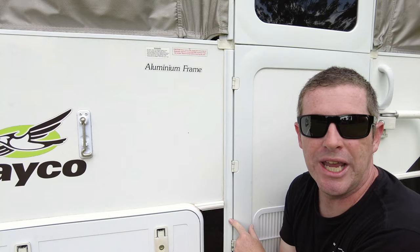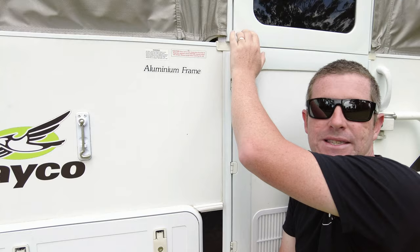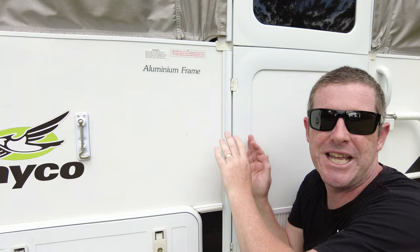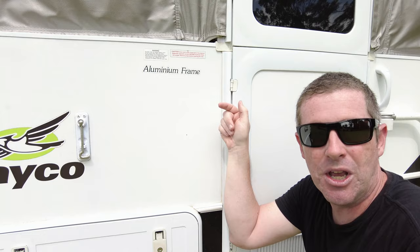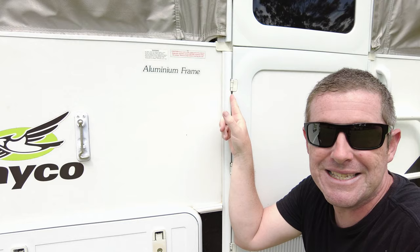Now, back out on the door hinges — a major weak point. I haven't seen a Jayco camper trailer yet that doesn't have at least the top door hinge a little bit crooked. That is sometimes due to the roof itself pushing onto this door when the roof is shut and you're in transit. Make sure there are no rubbing points or pressure points that will force this door down. What happens is these screw fixings do pull out of the internal door frame, which can be a little bit nasty to fix. The other failure point is that the hinge pins fall out, which isn't a huge drama, but I would still recommend replacing these hinges.